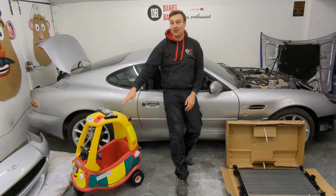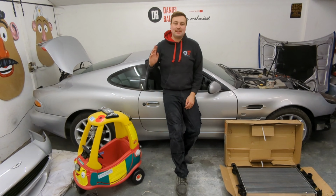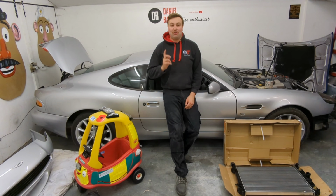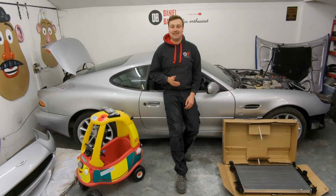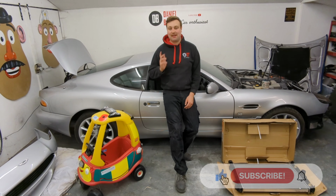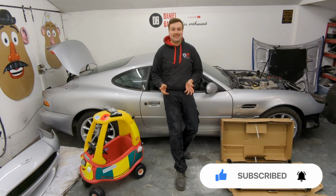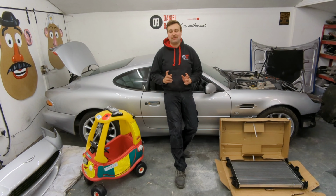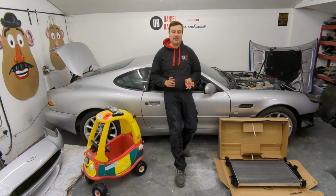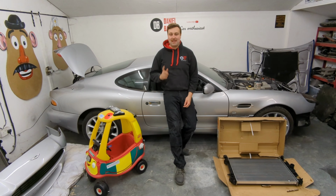I hope you enjoyed last week's video featuring this little dude, but we're back onto the serious stuff this week. So, little recap. Last time I worked on this Aston, I was going to fit a new radiator. Now I was going to use the Jaguar XK radiator from the late 90s. I managed to get a radiator, went to fit it, and it didn't fit. The transmission oil cooler pipes don't quite fit into the Jag radiator, the bore's slightly smaller. So in this episode, I'm going to try and modify it and make it work.